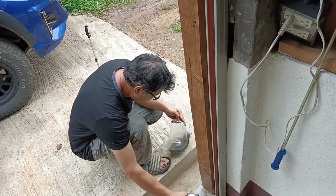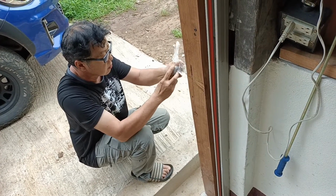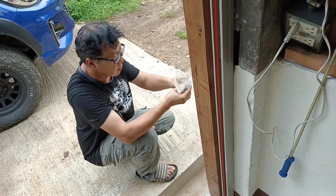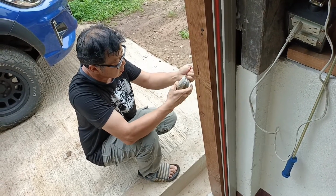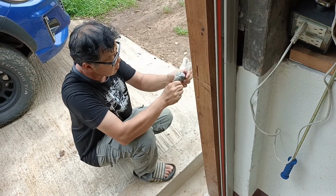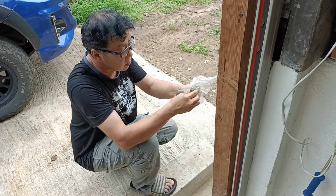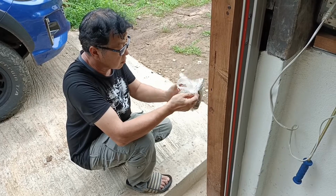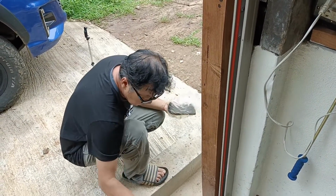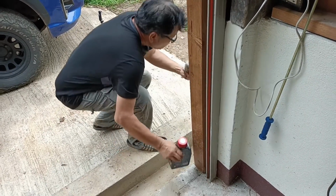Now you want to really squeeze that oil through the foam to get it distributed really evenly right throughout the foam matrix. So use a plastic bag and squash it up nicely. Don't wring it, just squash it. And that will get the oil distributed evenly like you want, whilst also avoiding an unholy mess on your hands. I'm pretty sure air filter oil is kind of carcinogenic as well, so again, another reason to use a plastic bag instead of getting it all over your fingers.